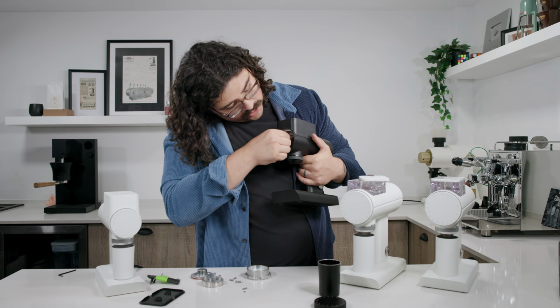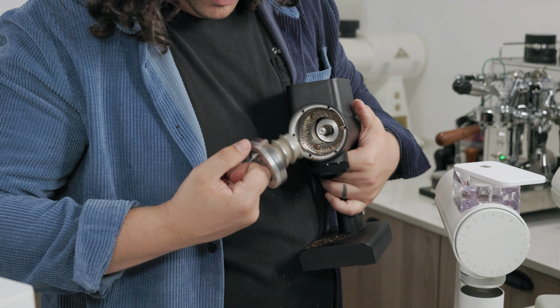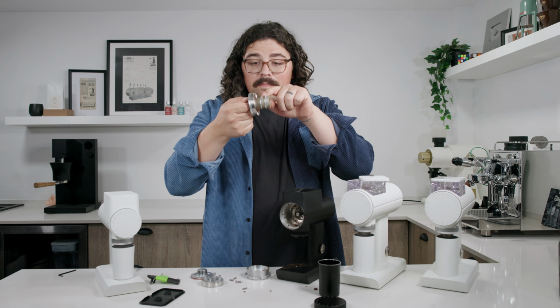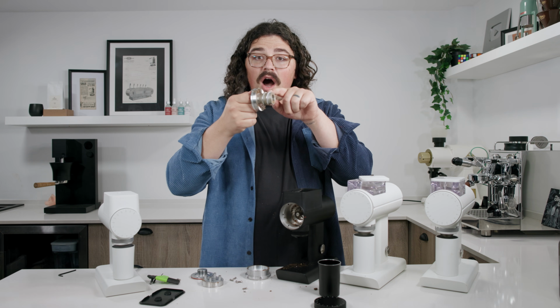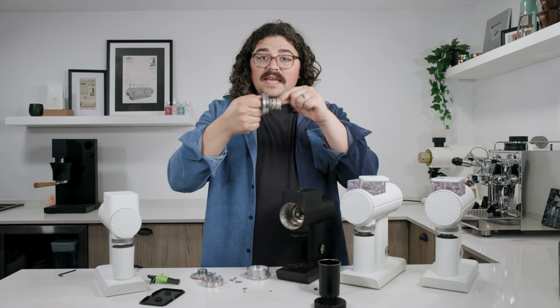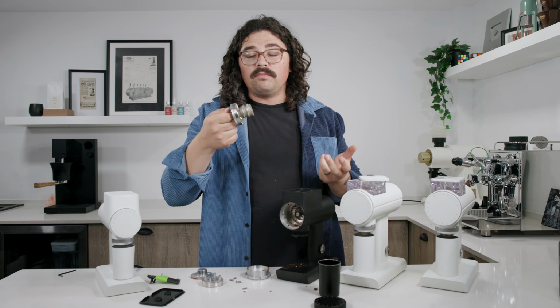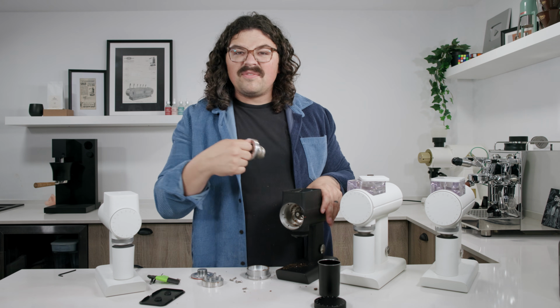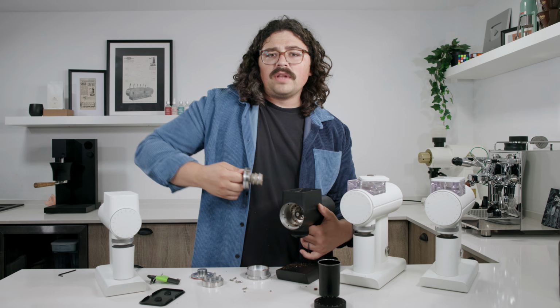You push it in and you're going to twist until those flaps are aligned, and then once you get it into the grooves, it should pull out. If it feels stuck, like a second ago, mine was stuck a little bit. If there's a bean that didn't finish grinding stuck in the auger, then it can get caught in the threading in there, and then you're pulling against essentially a full bean. So you want to make sure that it's fully cleared out before you pull the burr out, or it could feel stuck, and you've got to put a little elbow grease in there.